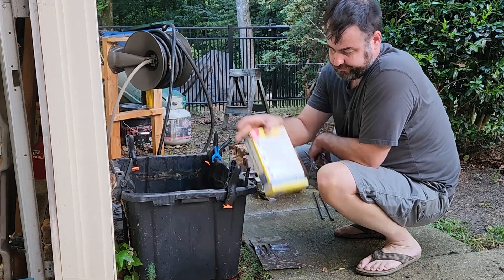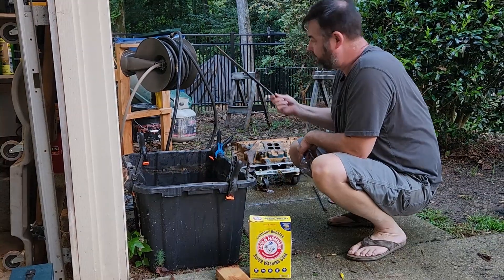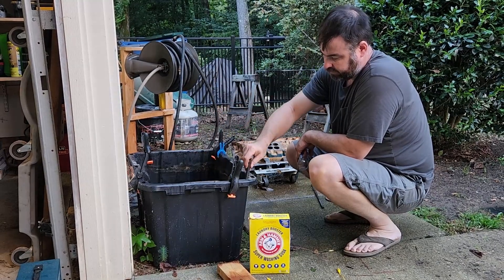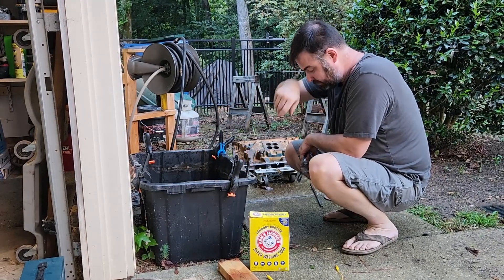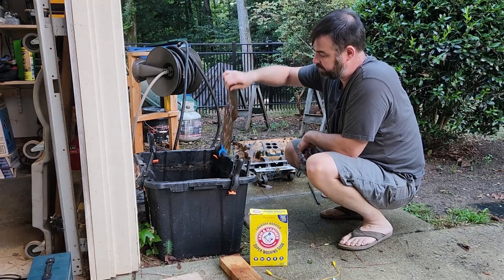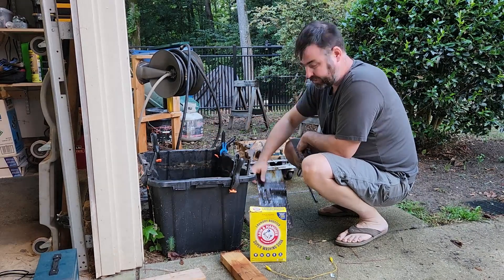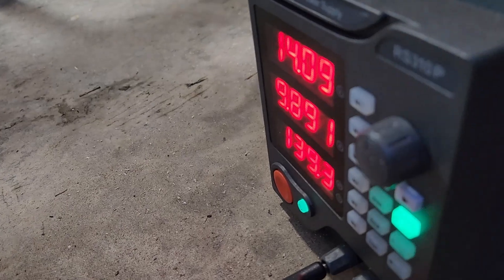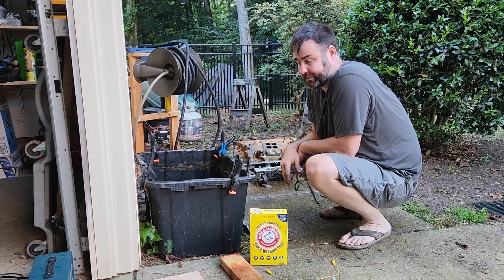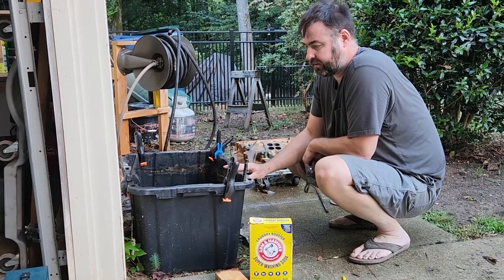It's really pretty environmentally safe — it's water, some soda suds, and electricity. I've got rebar mounted down in the corners as sacrificial metal, along with some scrap steel I was playing with the plasma cutter on. That worked really well because it had a lot of surface area. It'll pull a full 10 amps off the power supply. I'm going to try and keep the power supply inside the garage now in case it rains, because we've been getting a lot of thunderstorms lately, but I want to bring the tank outside while we do some work inside.